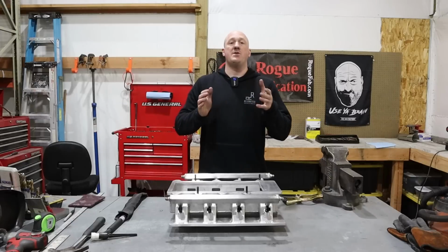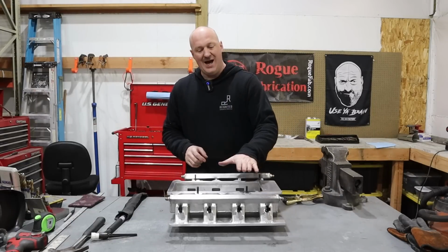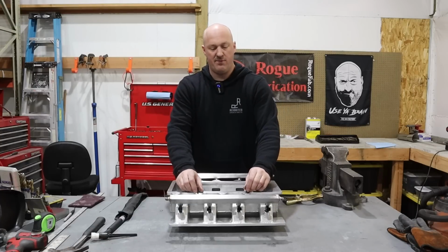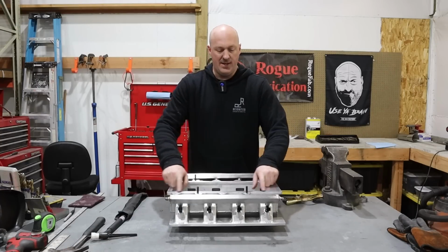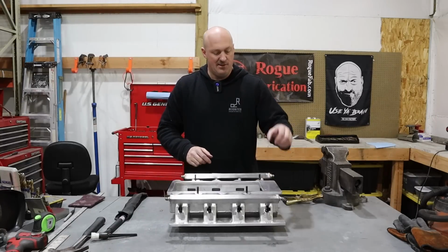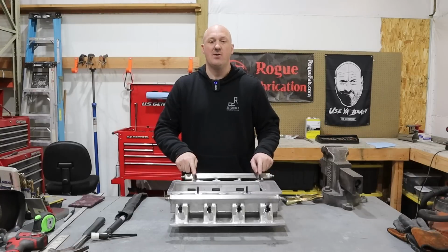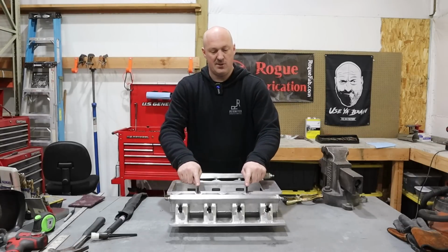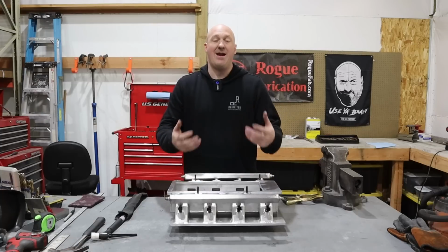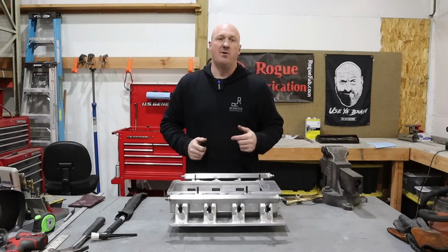So basically how we're going to do this is on the mounting for the fuel rails, I'm going to mount them on top of where the bolts go for this supercharger. So what I have is a number of these studs here that are gonna go in the manifold itself. The supercharger will go down on top of those studs and then there'll be nuts on the top of that. But on select studs, two here and two here, we're going to run some straps over from the fuel rail to the top of the supercharger there. That'll be what keeps our fuel rails in place. So let's get the supercharger on, start building those straps.